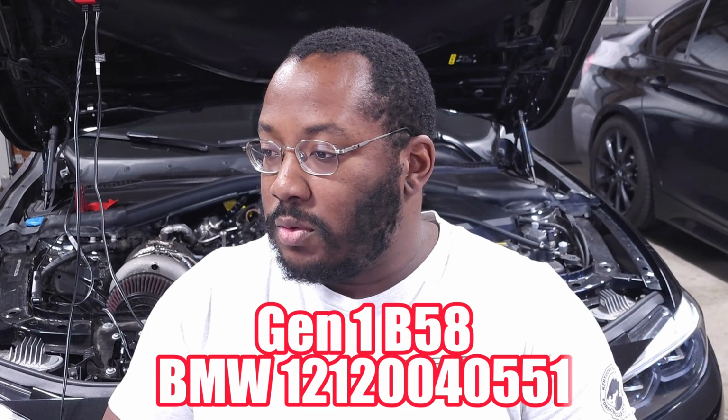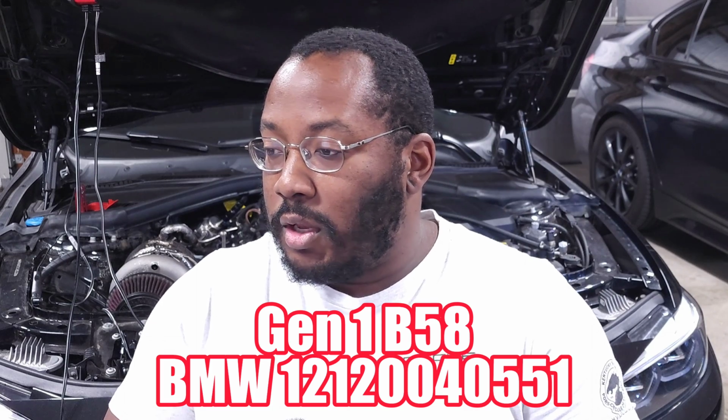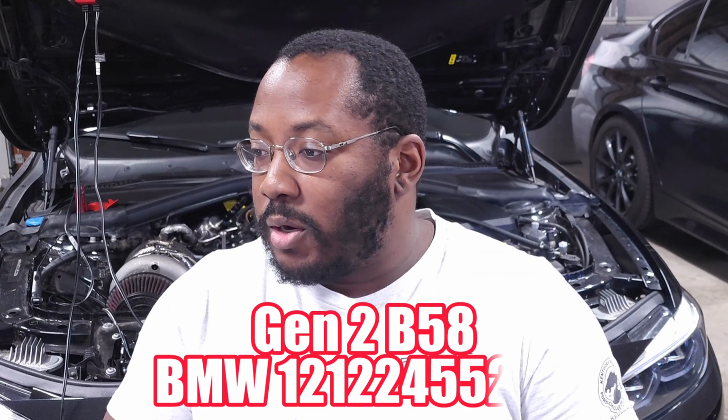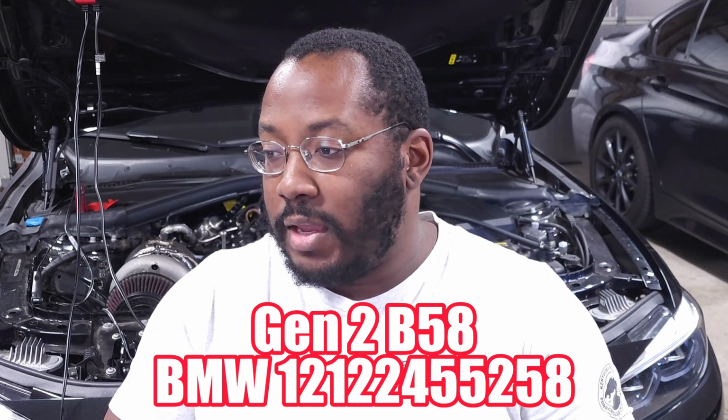However, as you know, the B58 is very different. We have very good spark plugs from the factory, and let's go ahead and talk about what those are. I'll give you guys some part numbers. So for the Gen 1 B58, our OEM part number is 12120040551. And then for B58 TUs, so that's M340i, Supras, all of the Gen 2 cars, your part number is 12122455258. So they do have different spark plugs from the factory.